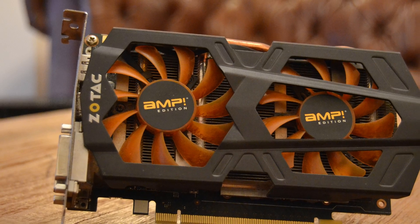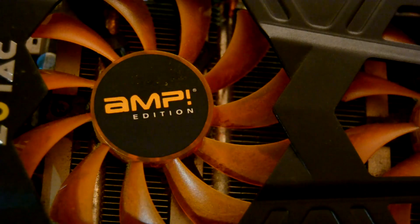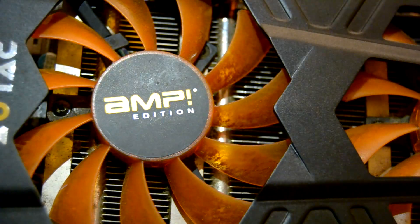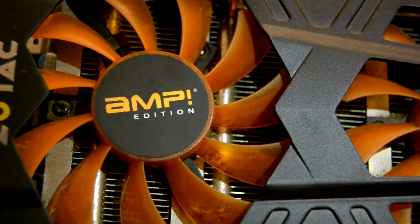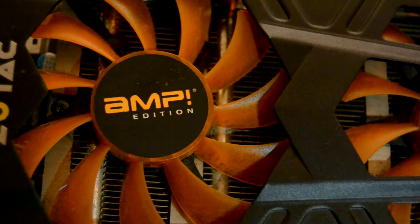This is not a precursor to modern variable fan technology. One fan — the fastest one, worryingly enough — is hitting the heatsink and giving a nice tick, and the other one looks like it's constricted by so much gunk and hair that it's actually slowing itself down. So it's obvious that this card needs some TLC.